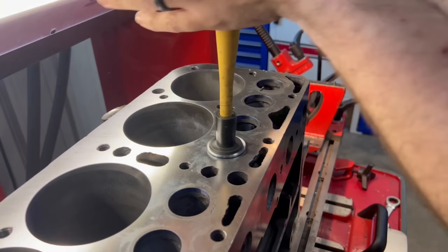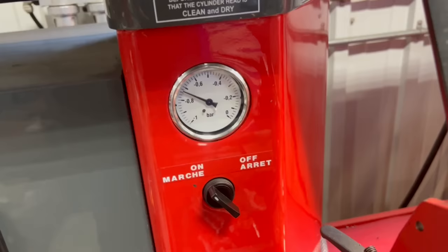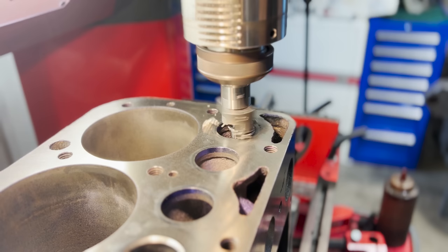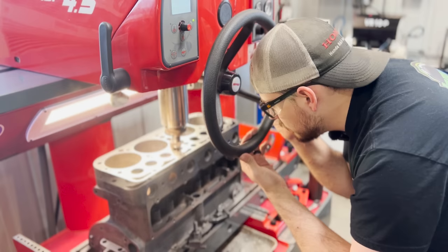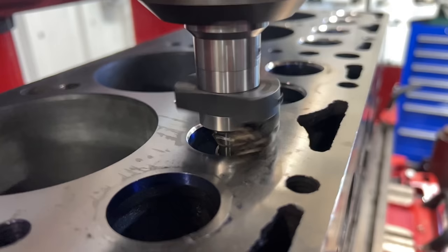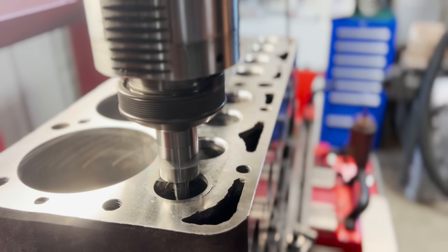You can see that at this point we've pushed the seat out a bit further on the valve face, but we're still not clear to the outer edge, which is generally good. The last check I did before moving on was to do a quick vacuum check on the valve, which checked out well considering the clearance in the valve guide with no lube or valve stem seal. We always check as we go because it's much easier to fix a poorly machined seat now than later on. At this point we're cutting the seats completely off of a visual — as we cut, we watch as the bottom angle comes in, followed by the seat angle, and when we just see a sliver of the top angle come in, we know that we have our full seat width and need to stop cutting to keep our valves at the same height.